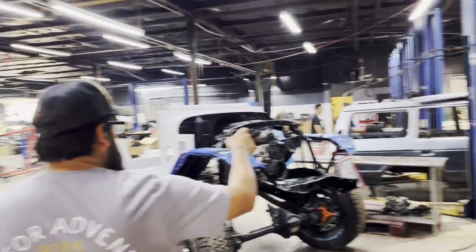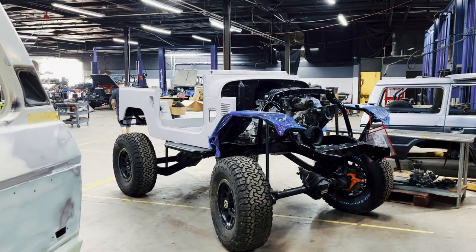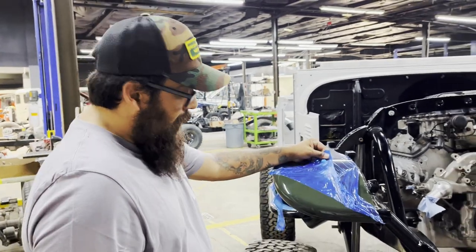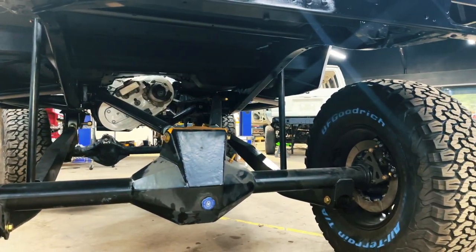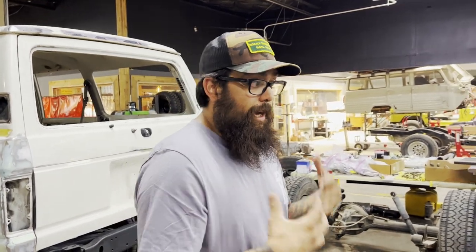Moving this way, we got another 62 over here. And then we have a pretty special one here. This is an LS3 with a supercharger — we're looking at about 650 horsepower. Basically all we had was a frame and we built everything off of it. The fenders and everything were built tubular. This is actually going to be color code TRD army green, which is a pretty cool color. We built all the suspension in-house. It's actually using Bronco axles front and rear, with a 4.9 inch Spider Trax locker on the rear. So this thing should withstand pretty good off-road jumps. Right now we've got King suspension getting rebuilt back at the warehouse. We should have 18 inches of travel front and 21 on the rear. So this is going to be a very, very nice piece for us to get out there. The public will be able to see the type of modification and suspension jobs that we can encompass here at Black Dog Traders.